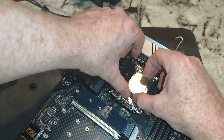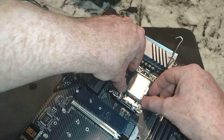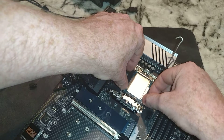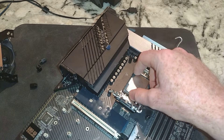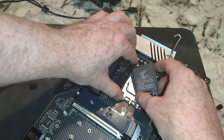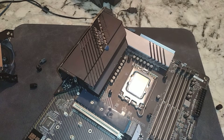I'm going to put this in here. I try a lot of times to do this two-handed just in case I drop it. You want to make sure this thing is level. So it's in there. Now you can pop this off if you want — the directions say leave it on. And boom. After I do that, I always check to make sure my CPU is still seated because I have seen this thing pop out of there. It looks good, so we're going to drop that down. If you don't do that step right folks, you will damage your CPU.